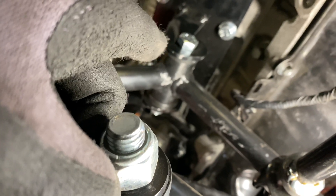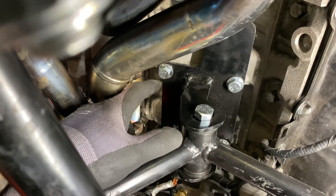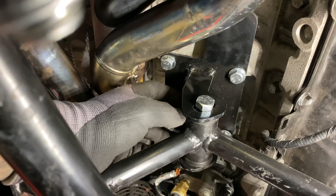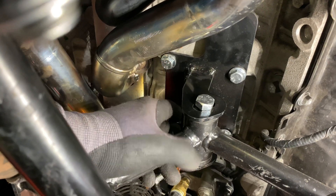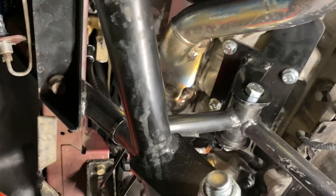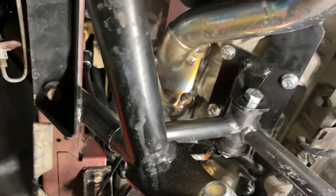I'm not going to take the motor mounts off or anything like that. What I'll do is pull that bolt out, and then I'll have this much space to come down while the transmission slides out. I'll have maybe three or four inches and I'll support the motor on top with that little brace right there. I'll give you guys another update once I get a little bit further in, but for now I'm just taking these nuts off and then I'll pull that header out and see if I can do it without pulling the motor.